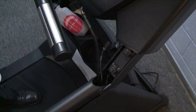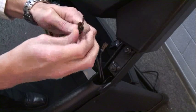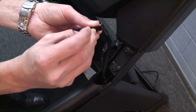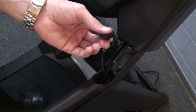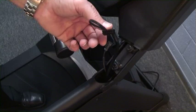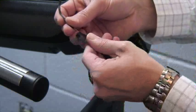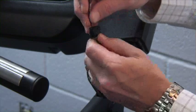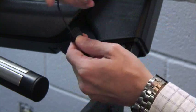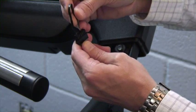What we'll do first is the incline. Now we're going to do the speed portion and locate pin 1 again. Pins 1 and 4 open the relay for the current for the motor. So we're going to activate 1 and 4, and once you activate them you should hear a relay click — like that.